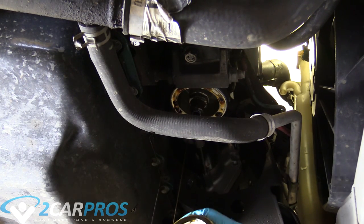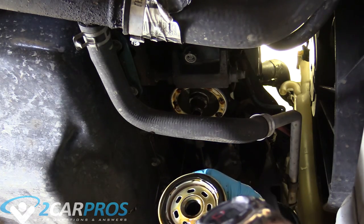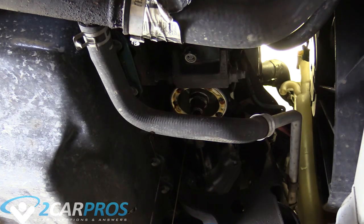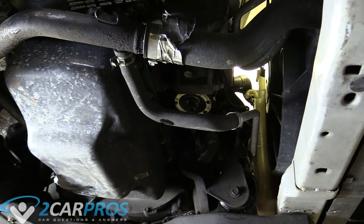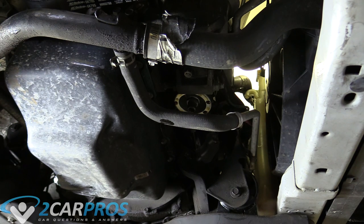When you are removing an oil filter, always make sure that the oil filter O-ring comes along with it. You can even look up at the mating surface to make absolutely sure that the O-ring came with your oil filter. The next thing we need to do is get our new oil filter — I'm using an ACDelco PF53 for today's job. I will leave a link in the description below.